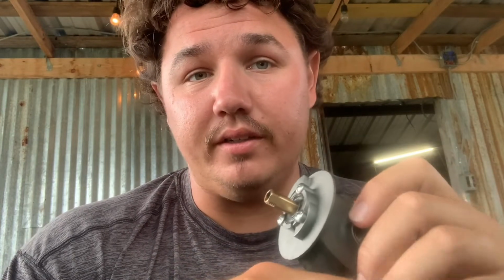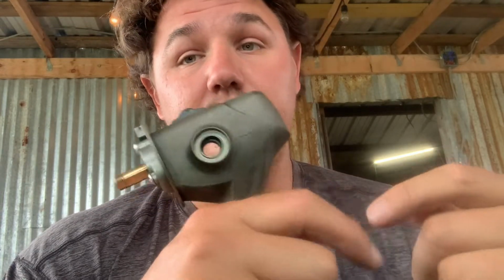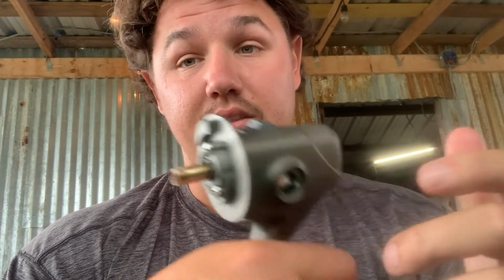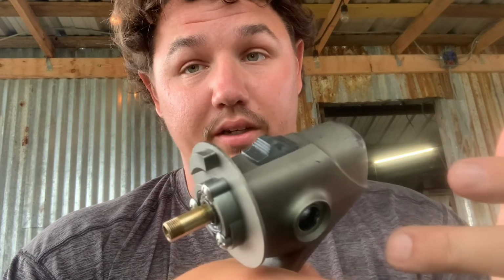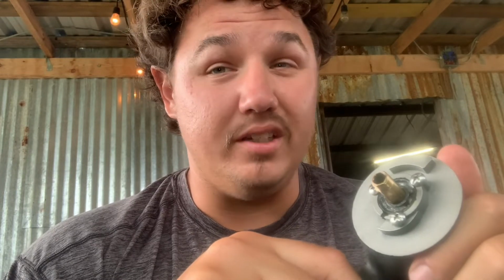Just one thing, when you're putting grease on the bearings, a lot of people just put the grease on there and think it's good. You need to put the grease on it, spin it, and make sure the grease gets down to the bearings. Because if you don't, guess what? There's no grease on the bearings. I worked with a dude once who did like 40 of these and there was no grease on the bearings because he just wanted to get it done.